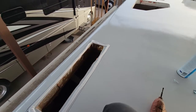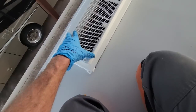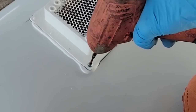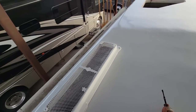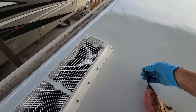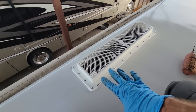That's what I recommend doing everywhere else, and that is generally what Winnebago uses on their sewer vents and TV antennas. Now I can put that back on, jiggle it into place — I already have a couple of screw holes right there. It'll ooze out, and these will act as nice clamps for the adhesive to set up. I want to reiterate something I try to say every time I do a video about a roof: this sealant here at the flange is the primary seal — this is what should keep water out.